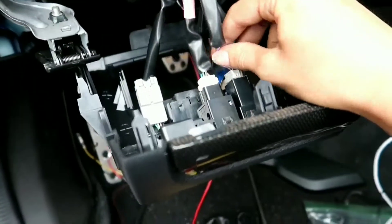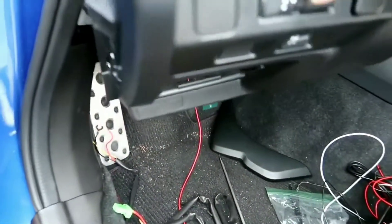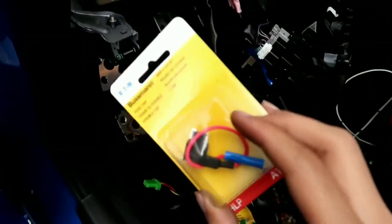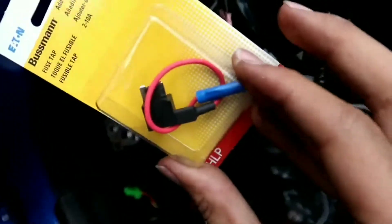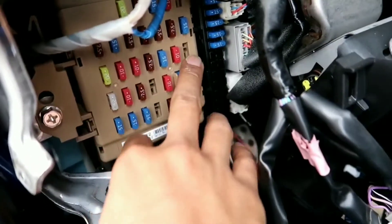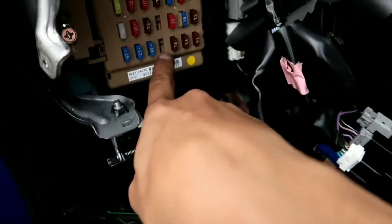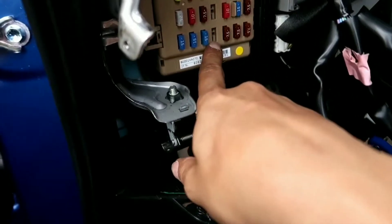You can just cut the factory wire and rewire it to what you need to make sure the kit works with your new kit, and then you'd have an OEM switch. I'm gonna have a switch that goes right here. What you're gonna do is take the right one — it looks just like this one, just the one with the longer one for the fuse. You're just gonna plug it in and insert the two fuses here on the side. Then this free one you're just going to be crimping to the end of the wire. You find an empty hole like right here or here — an empty little slot. Once you plug it in there, you want the wire to be on the top side, because from testing my car the power comes straight from the bottom and feeds to the top. So you want it on the opposite side so in case the fuse breaks it'll save your wiring and the car.